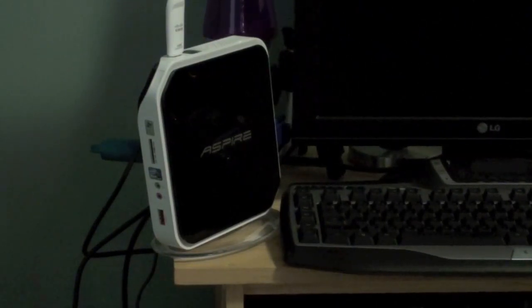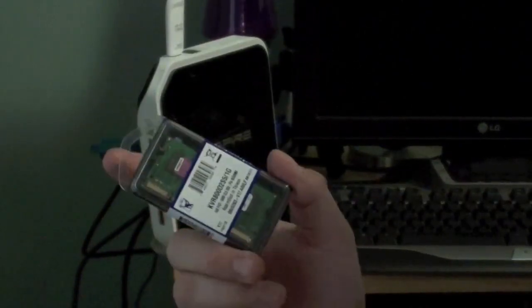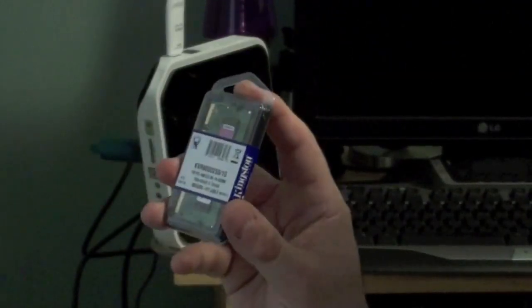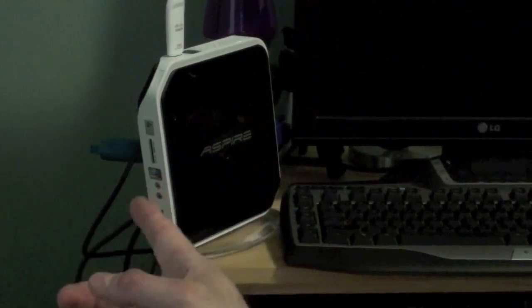What's relevant about this video is it is possible to upgrade these little machines with some RAM. This is a gig of RAM — I was able to purchase it on Newegg for the unbelievable low price of $18 with shipping. Since this only has Windows XP, going over 3 GB isn't going to do you any good with 32-bit Windows XP. I'll kick it up to about 2 GB, though of course the graphics are going to take 128 MB. But this is the best thing I could do to speed this up right now — it's pretty slow.